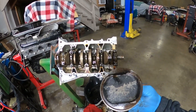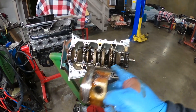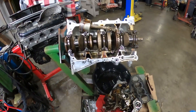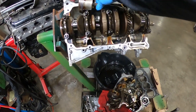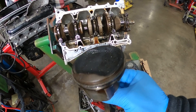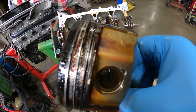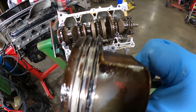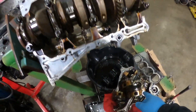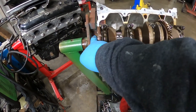There's carbon on top of the piston, so I'm just gonna go ahead and take the rest of the pistons off. If this one doesn't look that bad, I'm sure the others are gonna look even better. I got the rest of the pistons off — there is carbon on top and also carbon in between the rings, so it was probably definitely burning oil.